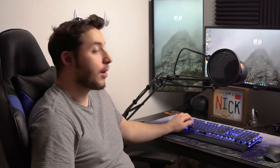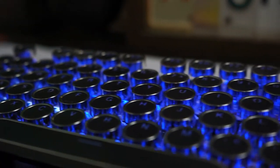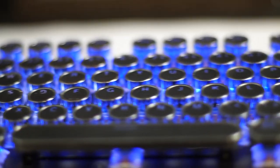I'm not gonna mess with it because it takes a minute to set back up. But basically the way you would set your keyboard — like I have it with mostly blue with a couple of keys being white — is you would hit Function and F11, and that'll put it into the mode where you can program different keys to have different colors. You can also do Function and Down to turn it down until it blinks in certain areas, which means the LEDs are at their lowest, and the same going the other way — it'll blink when it's at its highest, so you don't sit there for 10 minutes spamming keys with nothing happening.